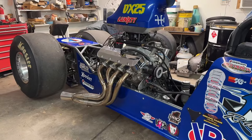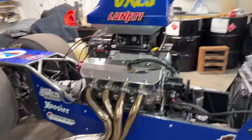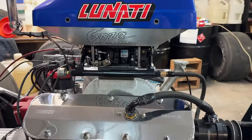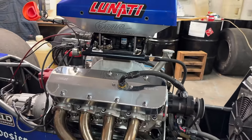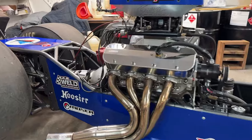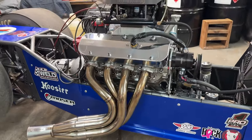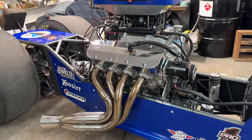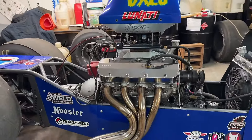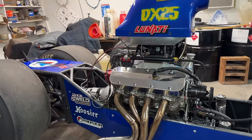This car has had a few motors in it. Right now it has an all-aluminum Donovan 540 with a West May 1050 carburetor. It runs on alcohol. He winterizes it — no spark plugs, he drains the fuel and lubricates it with fogging oil to protect the cylinders, carburetor, and fuel pump, and gets it ready to sit for the winter.